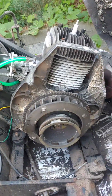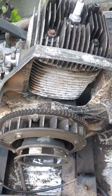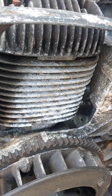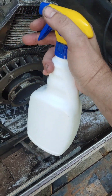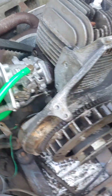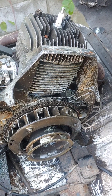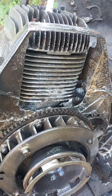That wasn't very fun, but I got a lot of stuff out of there. Now I'm going to come at it with some sort of cleaner or penetrating oil — I want to clean this right down to the aluminum so we don't have all this oxidization caked up on here. After consulting the internet, I decided to make a half-part white vinegar and half-part hot water spray and blast that all over this motor. Rumor has it this concoction is really great for knocking out oxidization on aluminum, so I'm going to soak it well, let it sit, then come back with a wire brush, screwdriver, and my 6-in-1 to get down into those slots and clean it up really good before blowing air on it again.